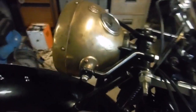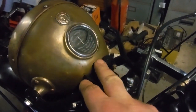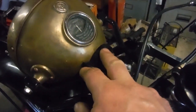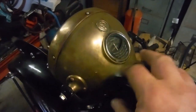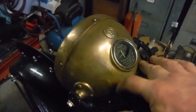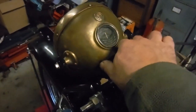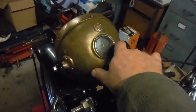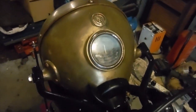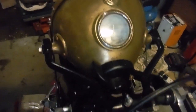And we managed to retain the original headlamp switch, but this originally took charge of all sorts of functions, even charging the battery and so on, and there's all sorts of nasty, damaged and worn and redundant terminals in there. A lot of that's been removed, but we managed to keep the switch and keep the basic functions of it by altering wiring and some other things. So that is still a functioning switch.